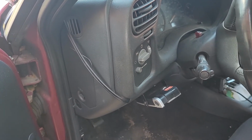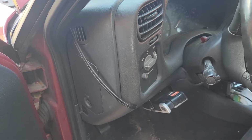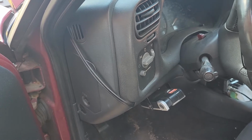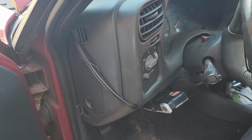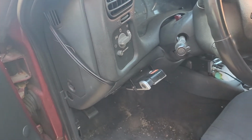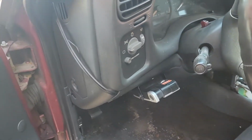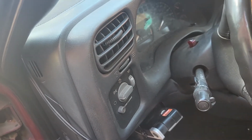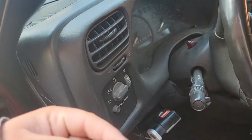in the back there was a center high mount trailer light wire. What that did is it turned the brake. It's activated by the third brake light, so it's not activated by turn signals or hazards. So I just ran another wire down the frame from that one. I connected it to that one, ran it down the frame in my wire loom that sends the brake line back, which we'll get to.